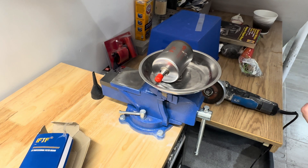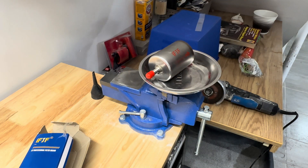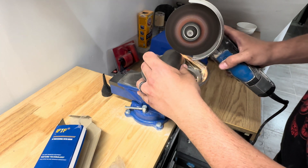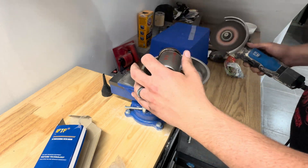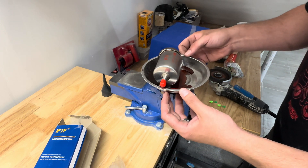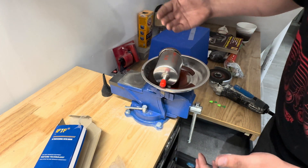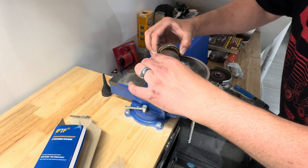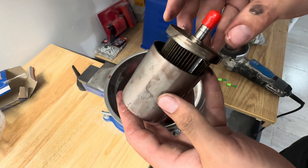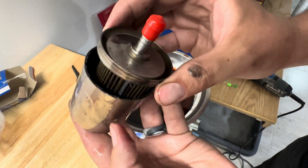Hearing and eye protection, and then we'll see what's up. So if we look, there's a weld — we just have to cut below that just so we know that we're getting it off. This isn't blood from my finger, that's just all the transmission fluid. This is just a standard magnetic bowl, and I like the magnetic bowl because you can see it's actually catching some of the filings. Unfortunately, I don't like the fact that you have to get a grinder in. I hope that we don't get any shavings into the filter, but there was no choice because it is quite a thick filter.